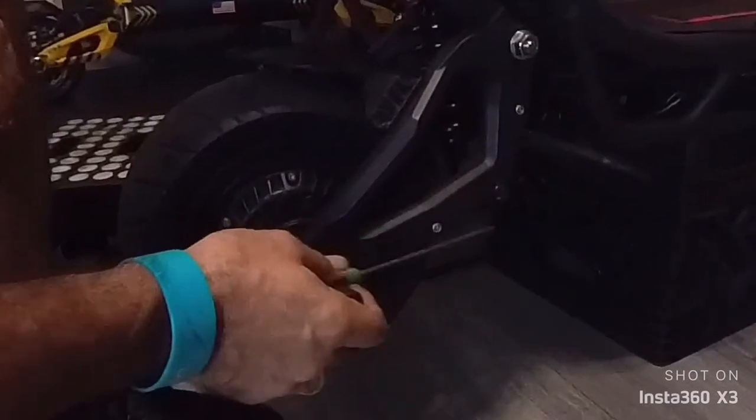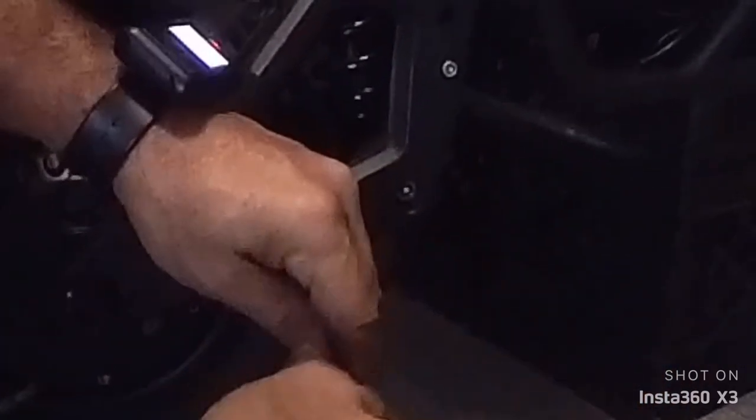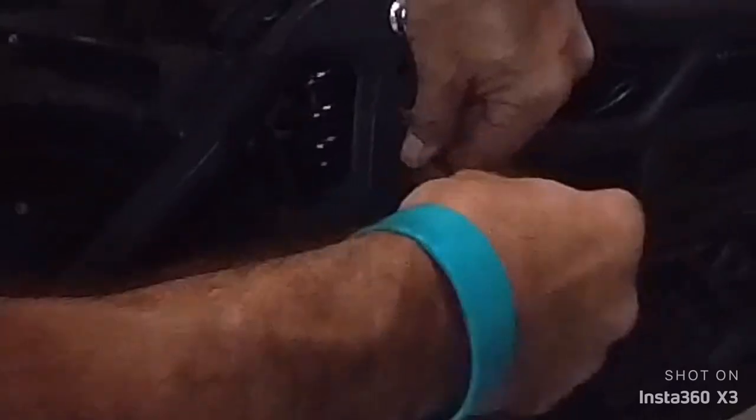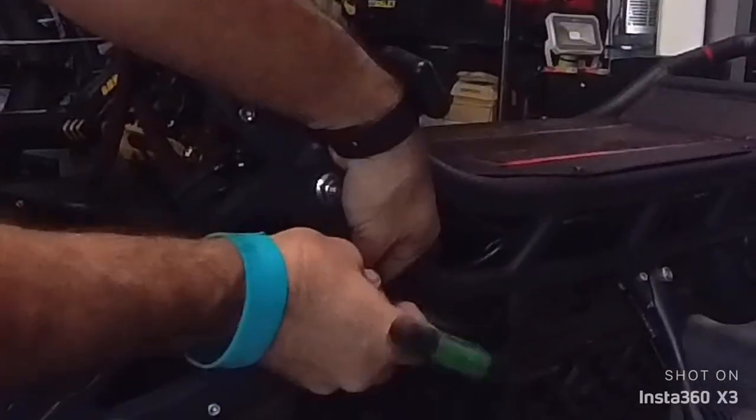Now what you want to do is loosen this bolt and this bolt because it's holding the motor cable behind, in a channel in the back. You're gonna see once I take it off, there's like a small plate behind it. So it will give you room to take the tire. Just put your hand on the back so you can grab that plate. See?